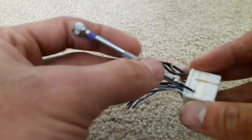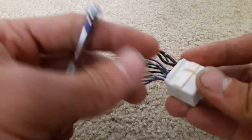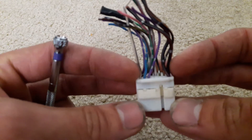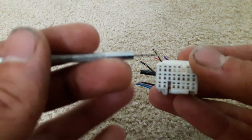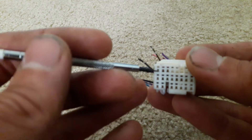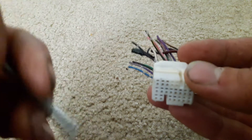So you want to pop open this gate — it's just a little snap there and you can see it's popped up. To remove the pin, all you have to do is stick your screwdriver in one of these bottom holes, which is kind of like the access hole, whereas the smaller one is where the ECU pin actually sits.